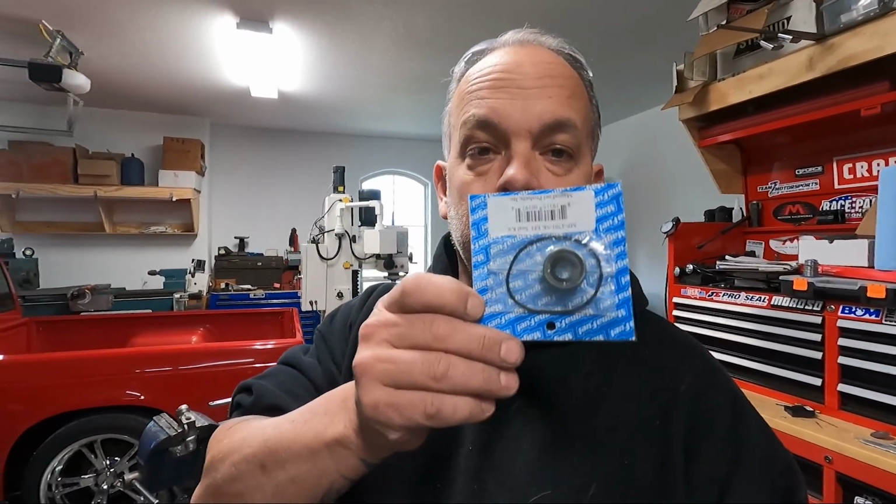So that pump's been sitting on the shelf for a long time, and it had a bad seal in it, so I had to get a seal kit for it, and for stuff like that, I always buy two. So got the seal kit in it. Fuel pump is in great shape. There was no scoring or anything like that on the gears. I think we were on to business, or pretty close to it.